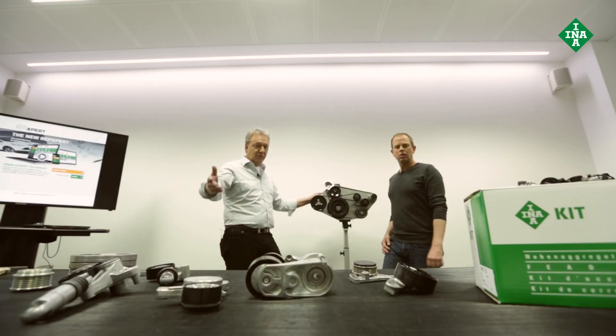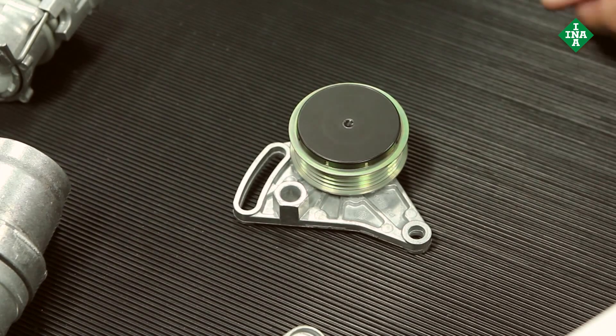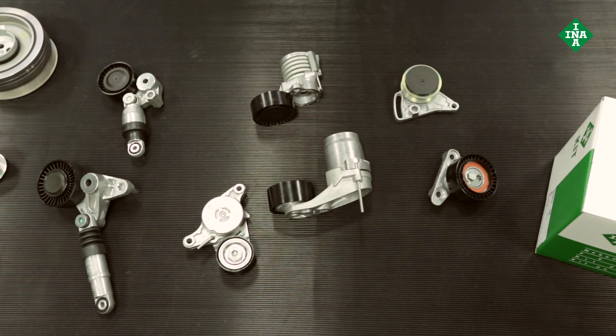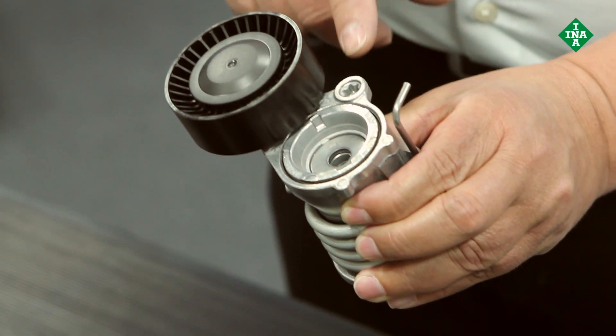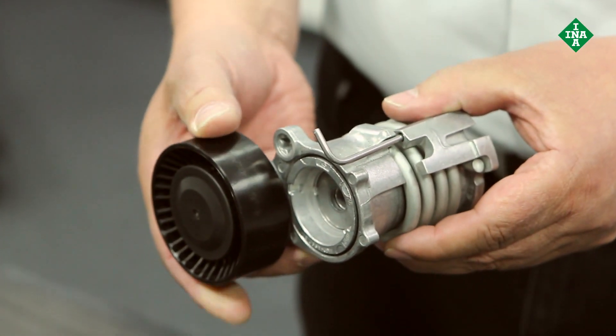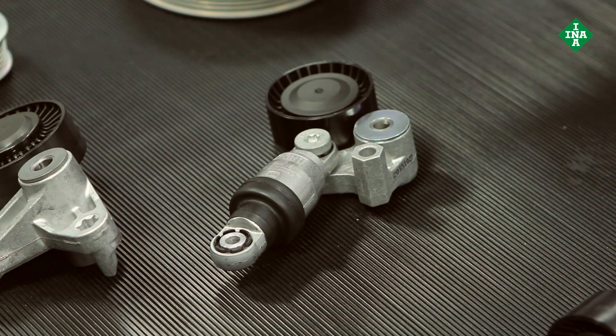What about these on the workbench? All tensioner pulleys. Essentially there are two different types of tensioner pulley: mechanical and hydraulic. The mechanical ones are again differentiated into manual and automatic versions. Manual tensioner pulleys are adjusted by rotating the base plate or an eccentric — the mechanic sets the belt tension. With the automatic ones, the force of the springs applies the correct belt tension. Working in combination with the internal friction elements, the spring movement is damped, making the belt drive smoother. When assembling, you twist the tensioner pulley against the spring force until the locking pin can be easily removed by hand.